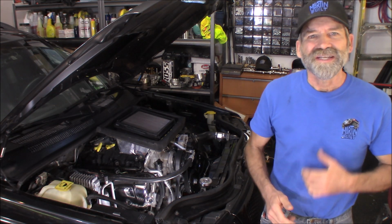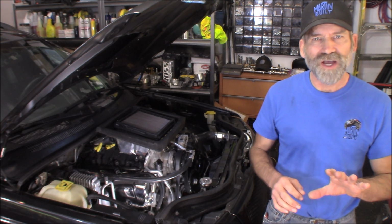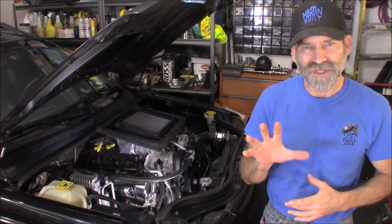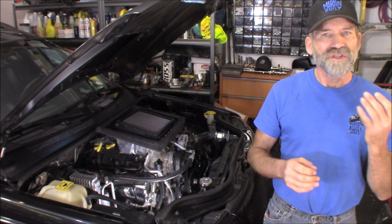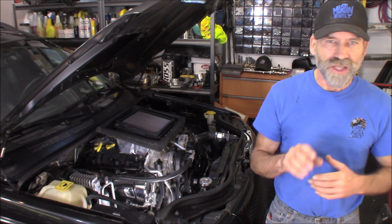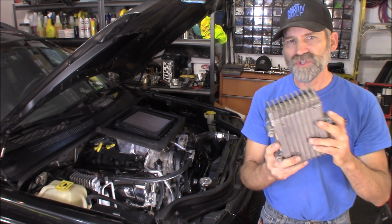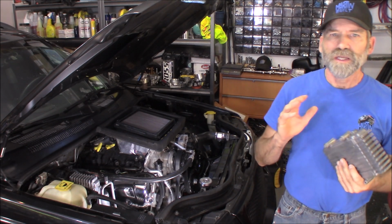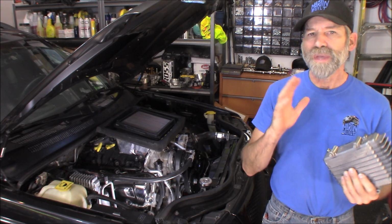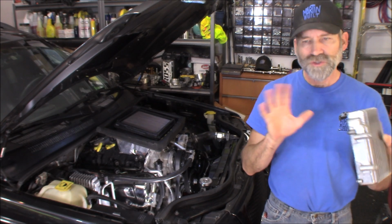Hi, Martin here. Today I want to talk to you about how to convert your 45 RFE to a 545 RFE, and what that is going from a 4-speed to a 5-speed transmission. And it is very simple. This is going to be for your 99 and 2000s Chrysler products that have the TCM or TCU that look just like this, your transmission control module. And in 2001 is when they made the change, so you may already have the 545 RFE in 2001.